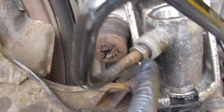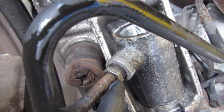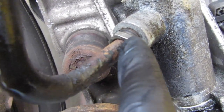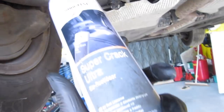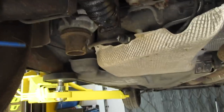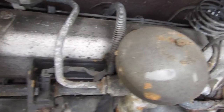Now when it comes to removing the union, we're going to have trouble. These two have not been undone since 2002 to 2016. The union spins, this pipe will stay where it is — this union should spin. I wire brushed gently all around here and I suggest you pick up some kind of rust loosener. Really, really take your time with this piece because if that goes wrong we're in a lot of trouble — the whole pipe will go all the way over. These won't come undone and that would be catastrophic.